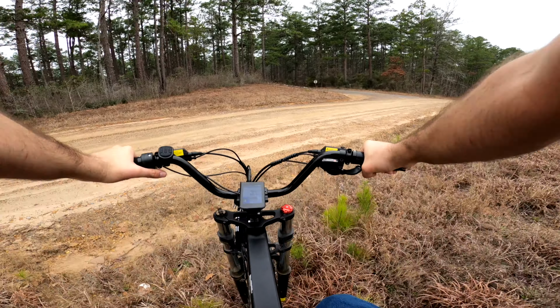Where I would say the X26 has a top speed advantage over the MC3, that comes with a catch. The X26 will technically reach 32 miles an hour on flat ground with my 210 pounds, but it's limited to a 3-minute burst, then it goes on cooldown for 5 minutes. And this complication is more of a gimmick in my opinion. I would have preferred the bike just to have been unlocked to the Class 3 regulations of 28 miles an hour, instead of dealing with buttons and cooldowns.